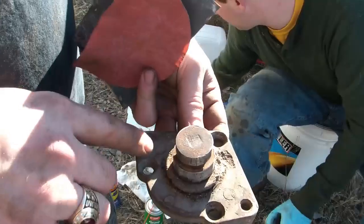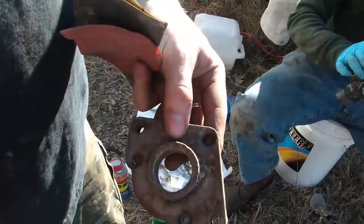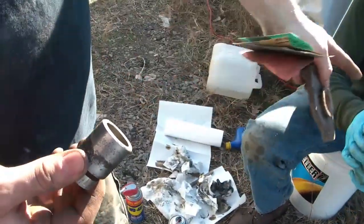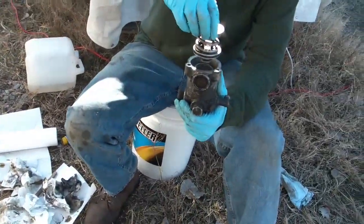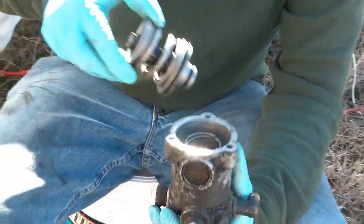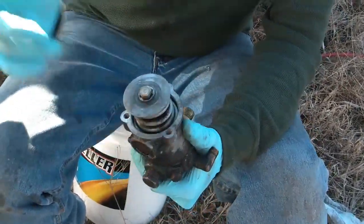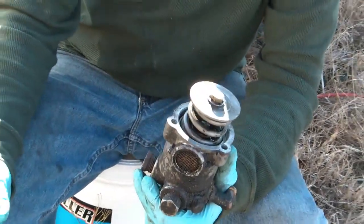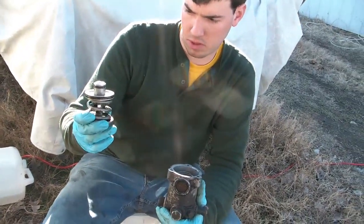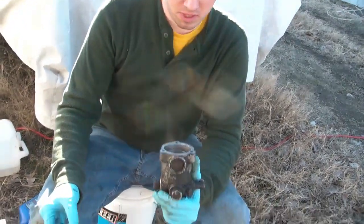This is the top of the application valve and the brake pedal pushes directly down on this. We finally got it out of the bus and it was all corroded and rusted and just seized up, and that's why it wasn't moving. We finally got these three screws out and got this freed up. We had to heat this with a torch, twist it free. Now I've just been sanding away. Rob's over here working on cleaning the inside of the valve. The innards were all fully oiled from the oil that was in the air system, enclosed away from the rust on the outside. The valve looks like it's good to go. The O-rings look like they're in good shape. We're going to put 40 weight oil on everything and bolt it all back together.